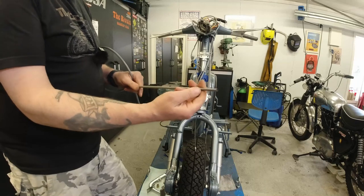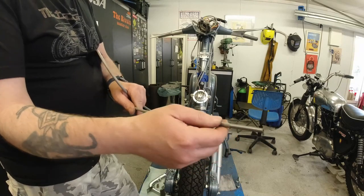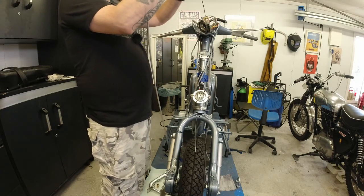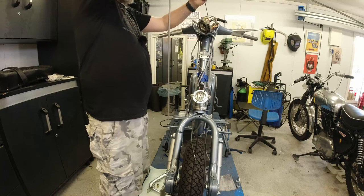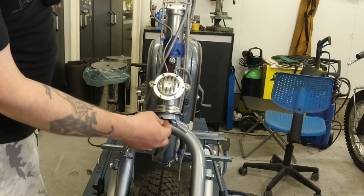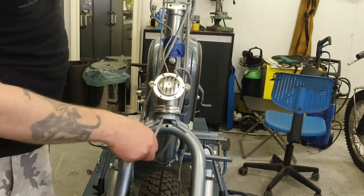Then I take the outer — you can see the rubber bit of the wire is stripped at the end, and that's the side that's gonna go threaded over the inner. I thread that up, drop the outer down and fish it out of the hole — there you go, it came straight away. Sometimes that can be a pain but today it wasn't.